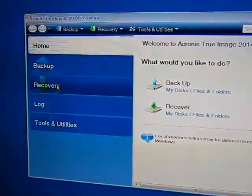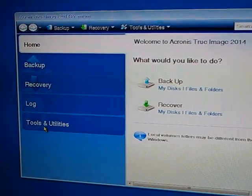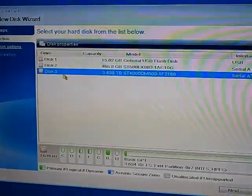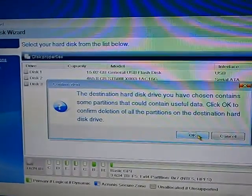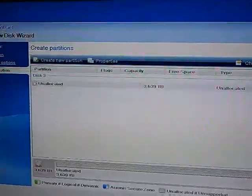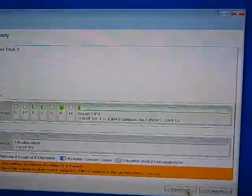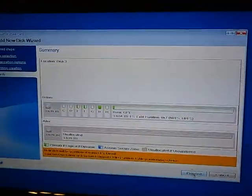When you're in here, go to Tools and Utilities, Add New Disk, select the Seagate Central hard drive, press Next. Initialize disk in GPT layout — that's important. Select unallocated and press Next, then Proceed.